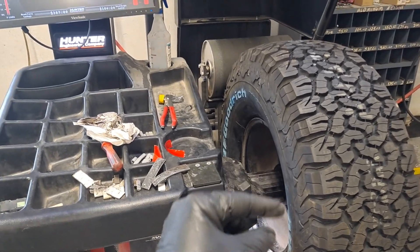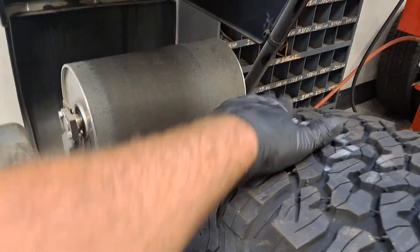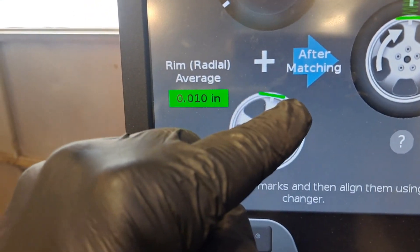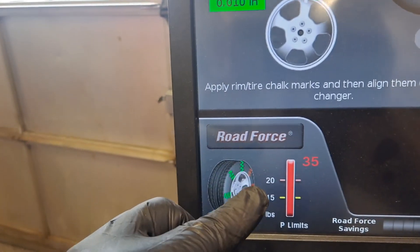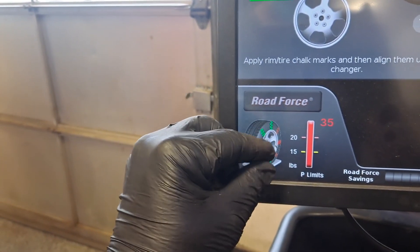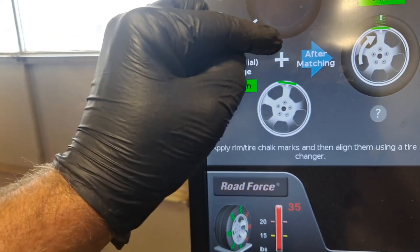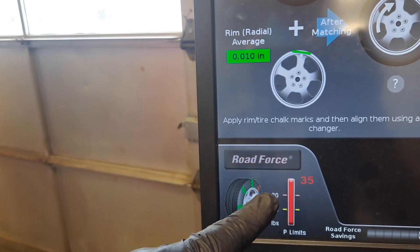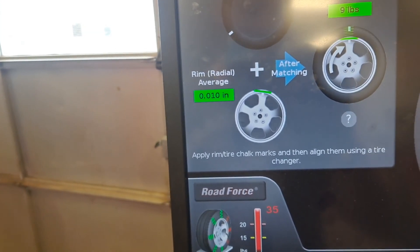When this roller comes down it simulates road force. We've got a little flat spot on the wheel — kind of like a bend. If you think about it, this hard spot in the tire going down the road becomes a lump because it doesn't flex in as much as the softer areas. If we have a flat spot — a low spot on the wheel — and a lump, which is essentially a high spot on the tire under load, we can line up the lump on the tire with the flat spot on the wheel, and it'll become a less severe lump.